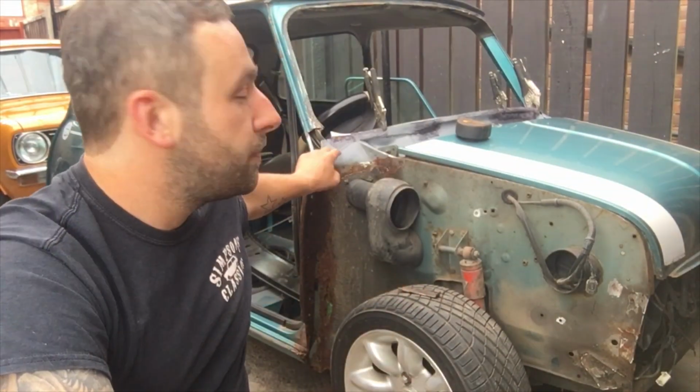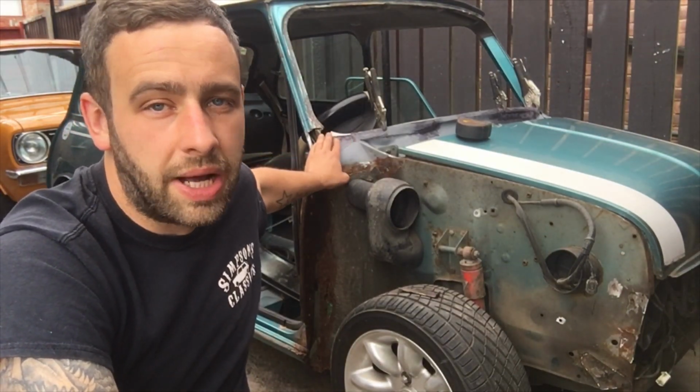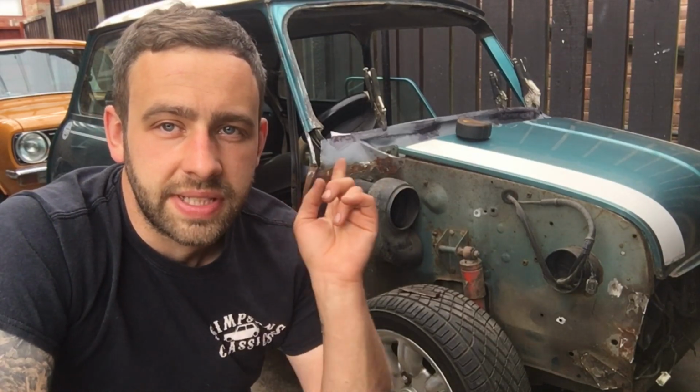and seeing really where metal needs to be. Because after looking at the 89, this plate here is merely just tacked to the dash rail. It's not actually a full piece all the way around. So I'm obviously going to try and make the metal up where that's missing, but I want to see where the scuttle wants to sit and things like that. So that is the aim of the game in this episode, but we really want to get the dash rail in place. So you can see the clamps all the way along there.